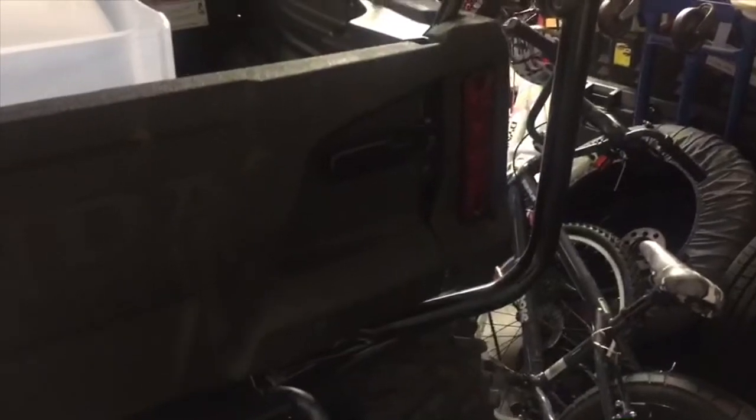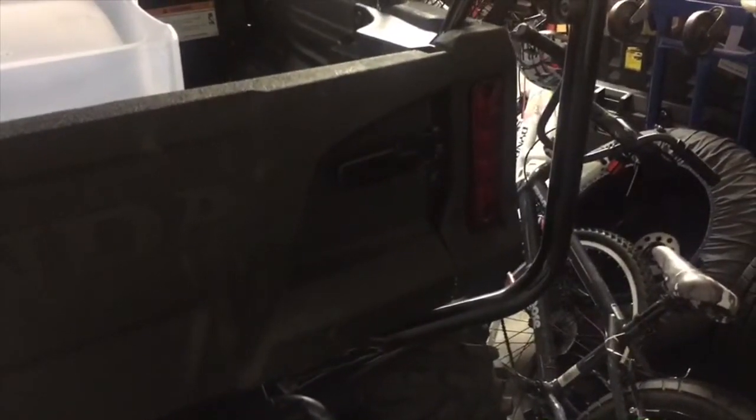So initially I wanted to put the backup lights right here behind both of the turn brake lights. Got a little lazy, so I ended up putting them down here. Ran the wires right here. I know it's a little dark, apologize. All I did was took the positives and the ground, went to the harness, soldered everything up. I put 2 different layers of wire loom after I soldered it and shrink wrapped everything up nice and tight.